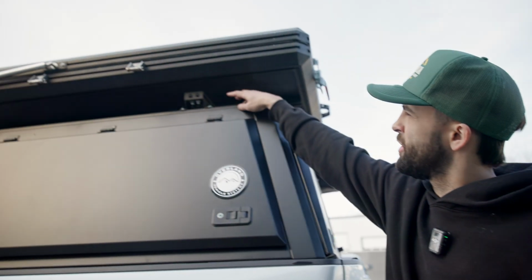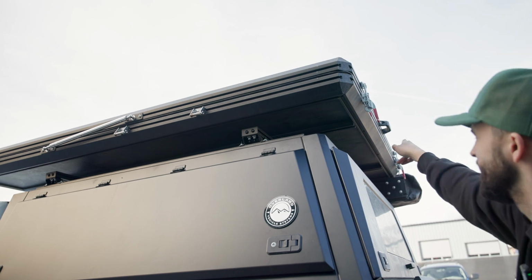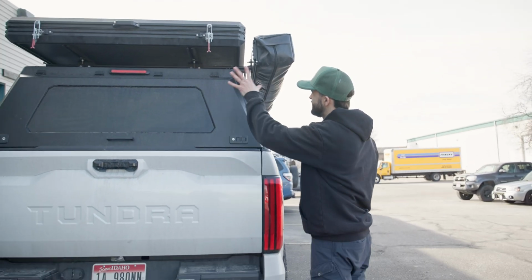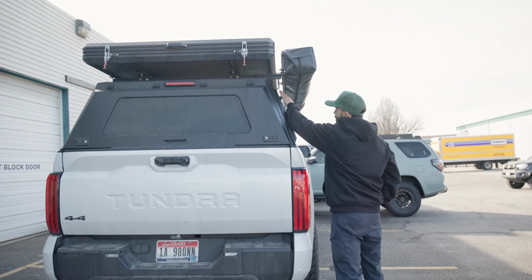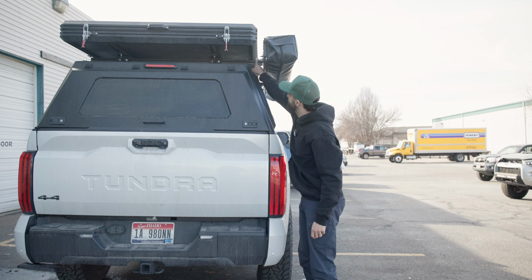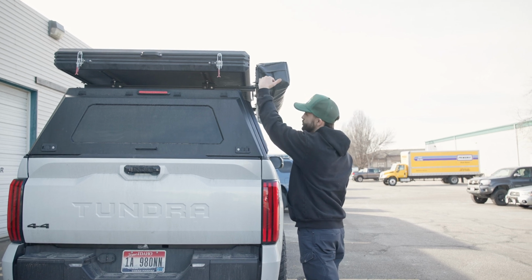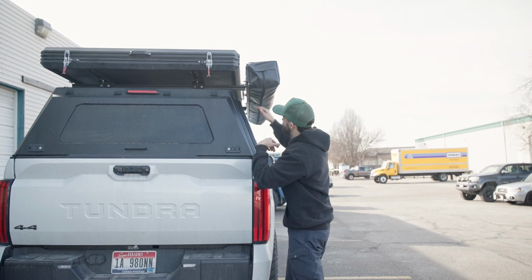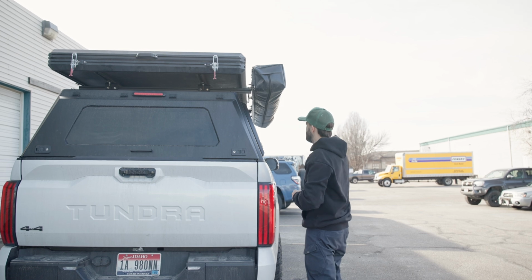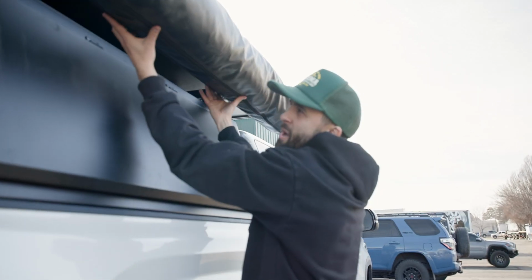This is their cross members. We pushed the feet on the outward position and then shifted the rails all the way to the passenger side, because this is where we mounted his awning, which worked out perfectly. It centered up the tent, or gave us enough room to center the tent, and then the awning occupies the last 6 inches of this crossbar, and the mount that holds on the awning goes all the way to the back. So we have 4. Yeah, there's 4 screws up here. Yep. So there's 4 screws on top that actually hold the mount to the cross member, and then you got the awning itself, and you can see this mesh part moves, but the mount does not.